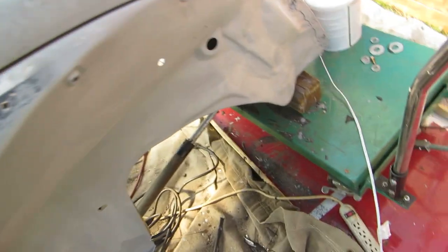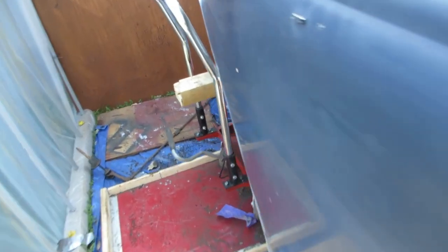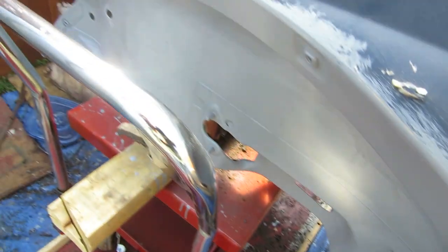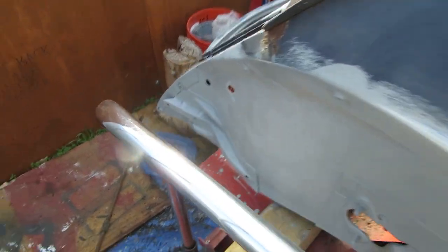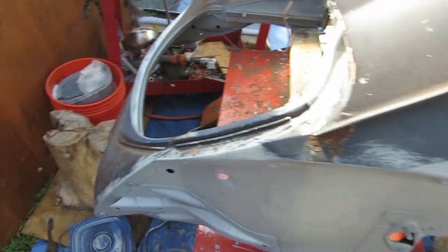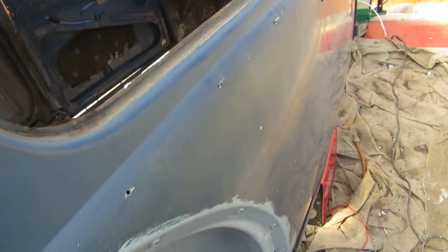Here's our prime job that we did yesterday with a brush. It looks marvelous, actually. And we'll do a real quickie on that with some wet dry 180. I'm not really interested in sand scratches. I don't care because it's underneath the fenders. But the primer that we're going to put on that, we're going to wet dry with 400. But I'll show you that later.